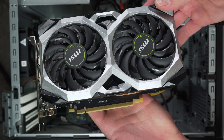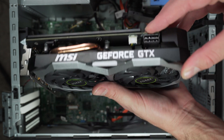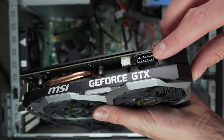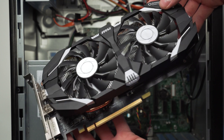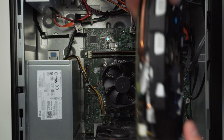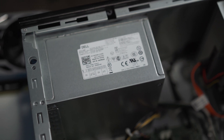Now let's get started with the first factor you need to take a look at when trying to run a GTX 1660 with a Dell Optiplex, and that is the power draw. The 1660 6GB model will generally be pulling 130 watts. Once you factor in the power draw of the Optiplex and couple it with that of the 1660, this should only be pulling about 10 more watts than when I ran the GTX 1060 6GB card in it. So it would actually be okay with the stock 290 watt PSU that comes in most of these Optiplexes.